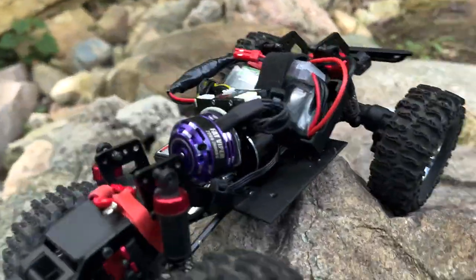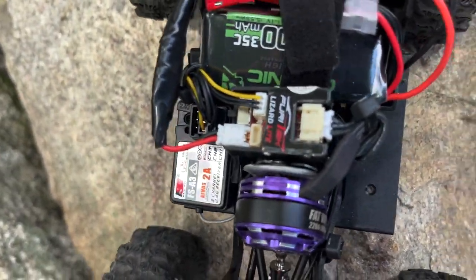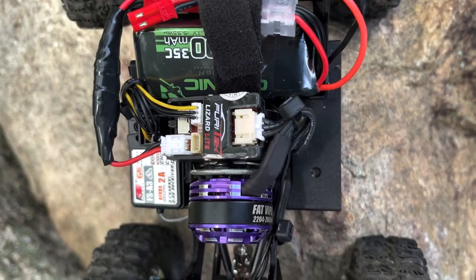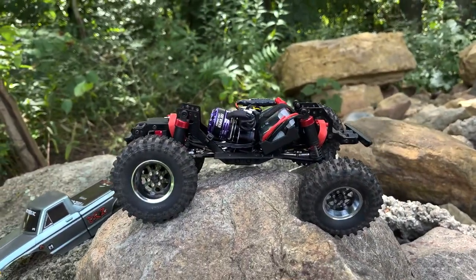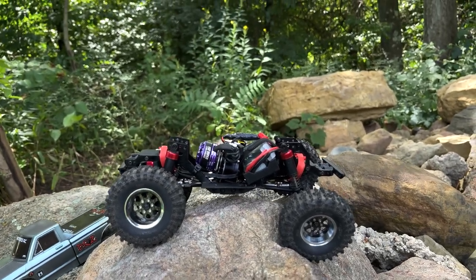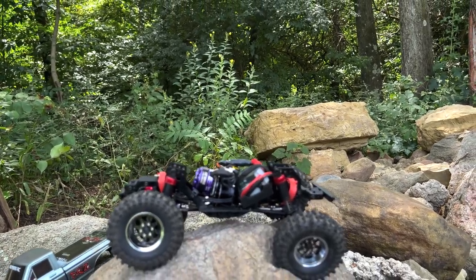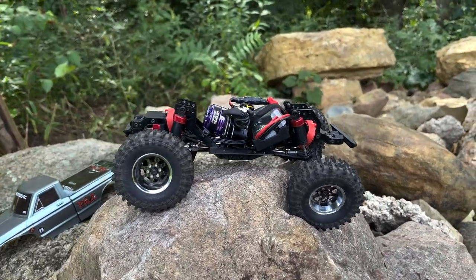That's what I did. Literally just a piece of aluminum spaced out on both sides of it, actually, to clear for bolt heads and whatnot. Had to do some clearancing on the inside of the transmission. Had to wallow some holes out. I mean, I wrecked this transmission to get this thing in there. You could not bolt a stock motor up to this thing if you wanted to anymore.